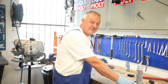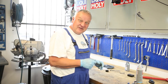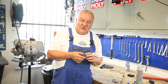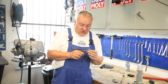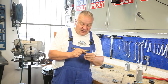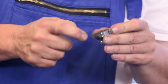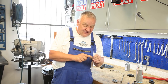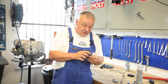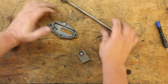I'm going to set that aside for now and go on to some other things we need to do to prepare for reassembly. Previously, we took the steering damper out, and I determined that this ball was loose on there. So I went ahead and welded it — it's all steel — then took the high spots off with a half-inch belt sander. Worked out pretty good.